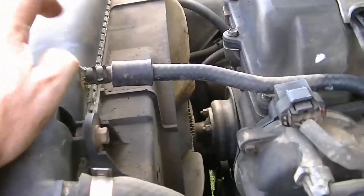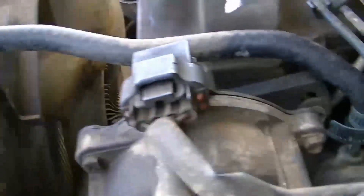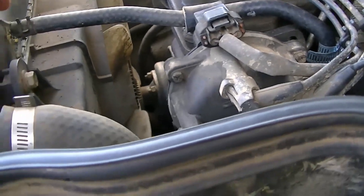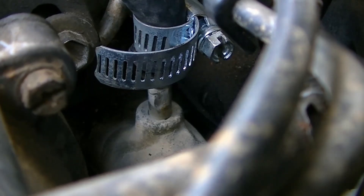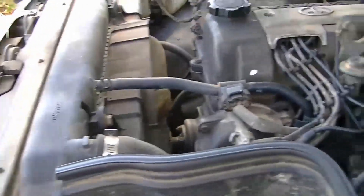Here's the hose — this is the breather hose that runs from the top of the tank on the radiator into the pipe leading into the top of the motor. You can see how I've had to fix it up and bodge it with a worm clamp. What we're going to do is take this off. This is about a half or three-quarter inch OD with an ID of a quarter of an inch. There's a riser off that water pipe — the hose does not go over that riser; there's another little thing which I've got the worm clamp wrapped around. Let me get the tripod and we'll try and get this hose off.